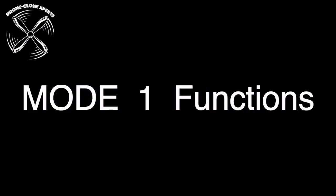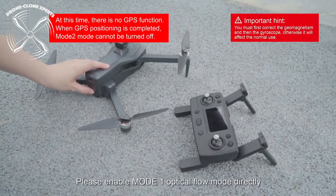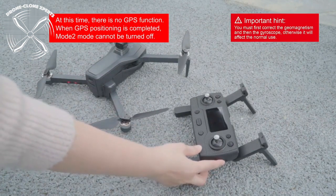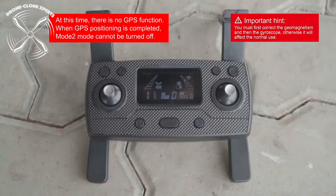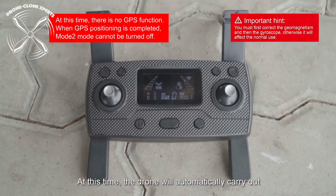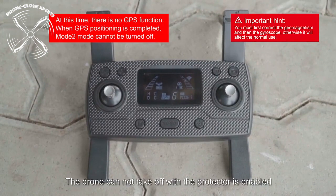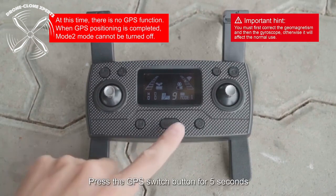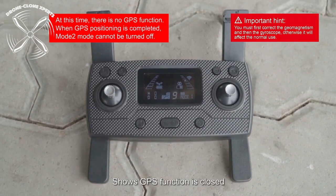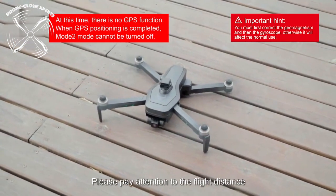The following functions only work in Mode 1. Be careful, because the drone doesn't have GPS in Mode 1. Mode 1 is meant for flying indoors in a wide open space such as a gym, but can also be flown outside in areas where GPS signal is too weak to reach Mode 2. For example, if you're completely surrounded by tall buildings that aren't allowing a good GPS satellite connection, you would fly in Mode 1. You can activate Mode 1 flight by holding down the middle button on the remote for about 5 seconds. When flying in Mode 1, there's no GPS connection, meaning the drone won't know where to fly back to if anything goes wrong.